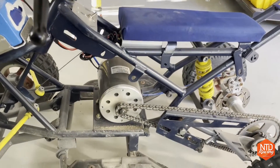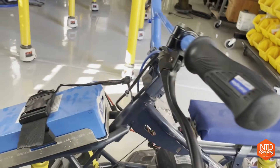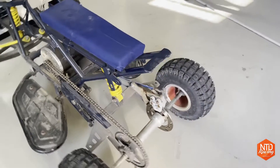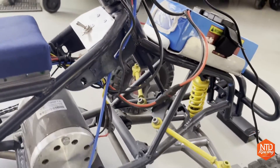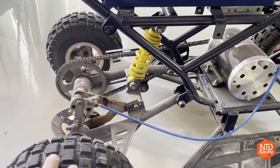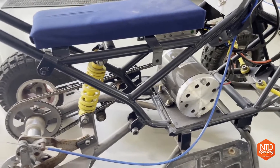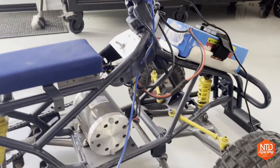That's a nice feature for electric motors, but this one is not a spring return, so I've ordered another brake that actually has a spring return — otherwise it kind of just dangles in there and that wears on my brain. Besides that, my little boy did all the painting and I think he did a pretty good job for a six-year-old. The wires are just bundled up inside — we may clean that up in the future. My buddy and I were talking: with as much torque as this thing has and how it tries to throw you off the back, we're thinking about extending the rear trailing arm, moving the motor back in front of that sprocket, and putting the battery underneath. It would clean up the design and get that chain away from catching fingers.